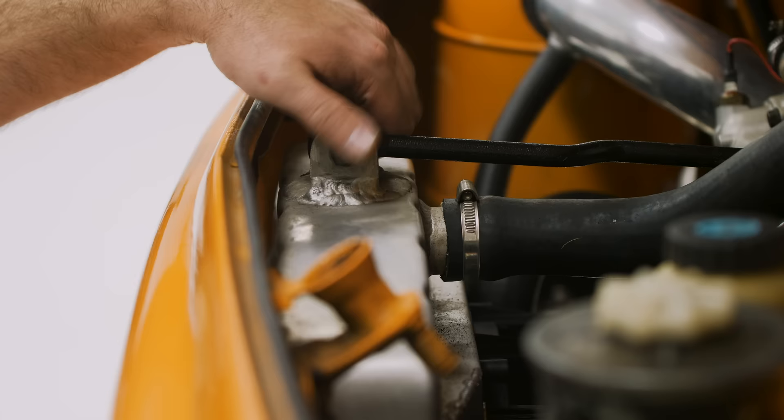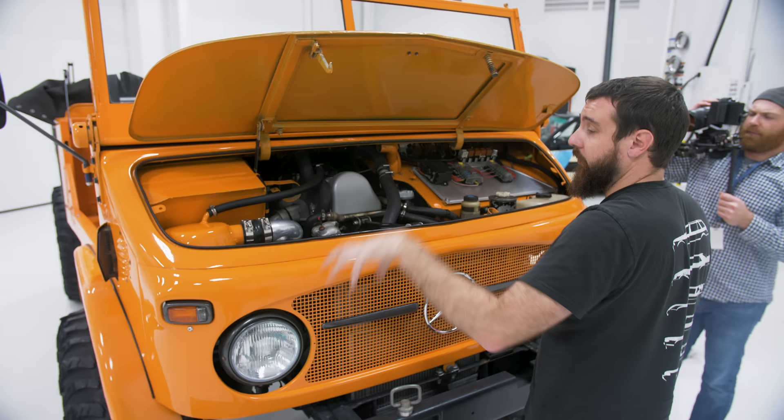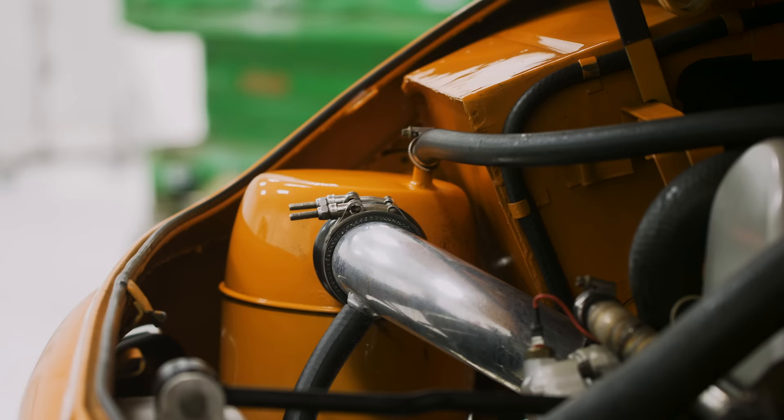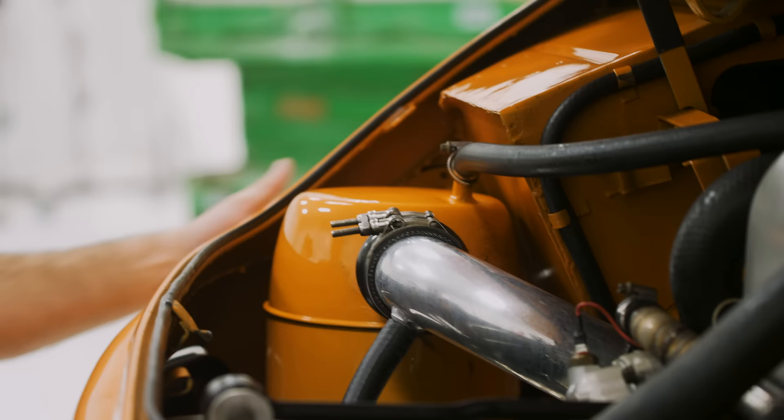It's using a factory-style air box, but these originally had an oil element to clean the air — it just pulled air through a little oil screen so the oil would grab all the dirt. But diesels can run off oil, so you don't want to do that. I cut it apart and welded a new tube in, and there's now a typical cone air filter in there. The air box looks the same and still pulls in through these cool-looking vents on the outside, but it's more functional for this engine.